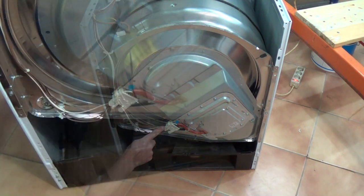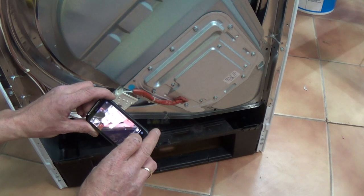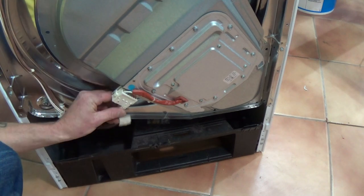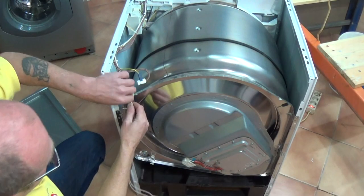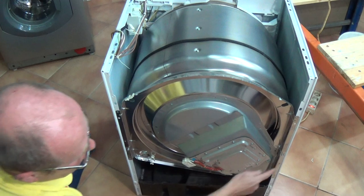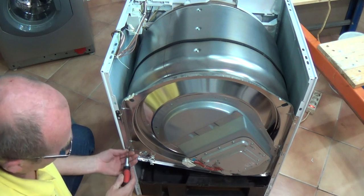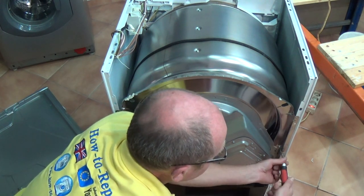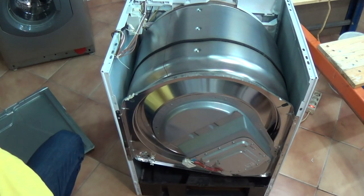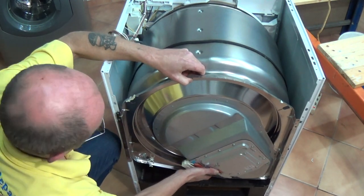The first thing we need to do is remove the electrics from the heater unit and take away the wiring. The whole of this back support plate actually comes off the machine to change the belt. Just unclip all the wiring and get it out of the way. Next you'll find there are two screws, one on either side — just take these out. Then just above those screws you'll find two clips that lock into place on the chassis of the machine.